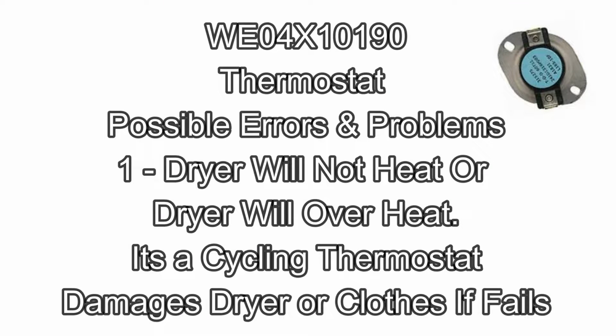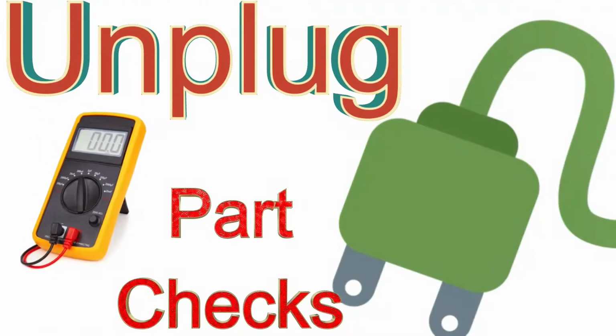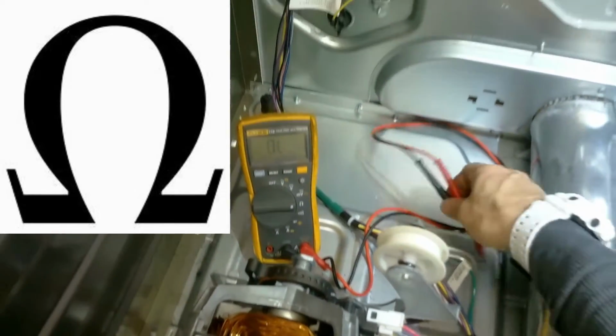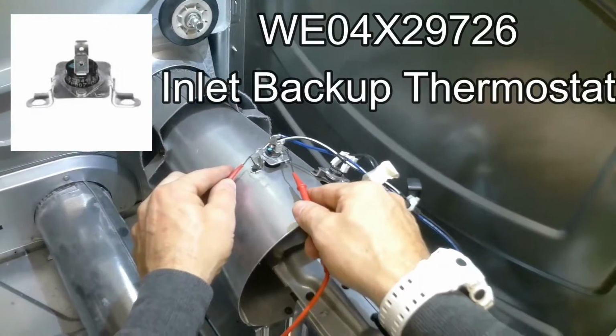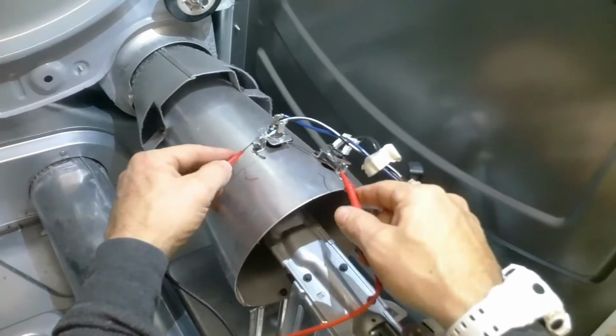So the next part of the video we'll show you how to test with the multimeter. Definitely make sure you unplug it. If you're not comfortable, just get a technician to come out and do it for you. So if you have a multimeter, put it on the ohm settings, and then you should do a continuity check. Here's the part number. I will try to leave these in the description below.